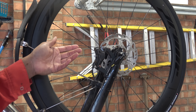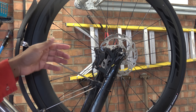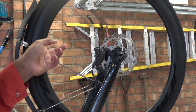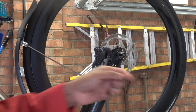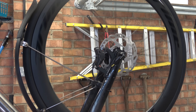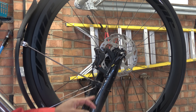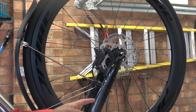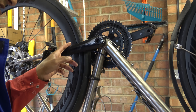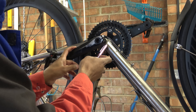The other more pressing reason is — if we do this — you can hear it rubbing. So that really annoys me, but it's not my bike. The fork on this appears to be carbon; the rest of the bike is titanium. Upon initial inspection, this looks like it has not been stress relieved — the bottom bracket and the frame itself doesn't look like it's been stress relieved.